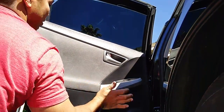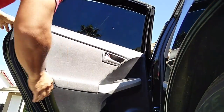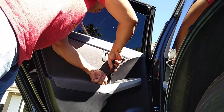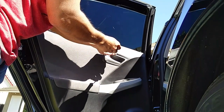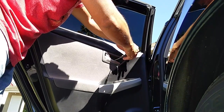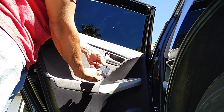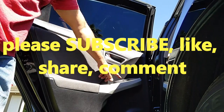After that you're all done — very easy to remove and reinstall these door panels. Make sure you screw the two Phillips screws back in by the door handle and by the lever, then replace the foam cover and snap the plastic trim piece back in place. You're all done! Thanks for watching — please give a thumbs up, leave comments if you have questions, and please subscribe, like, and share.